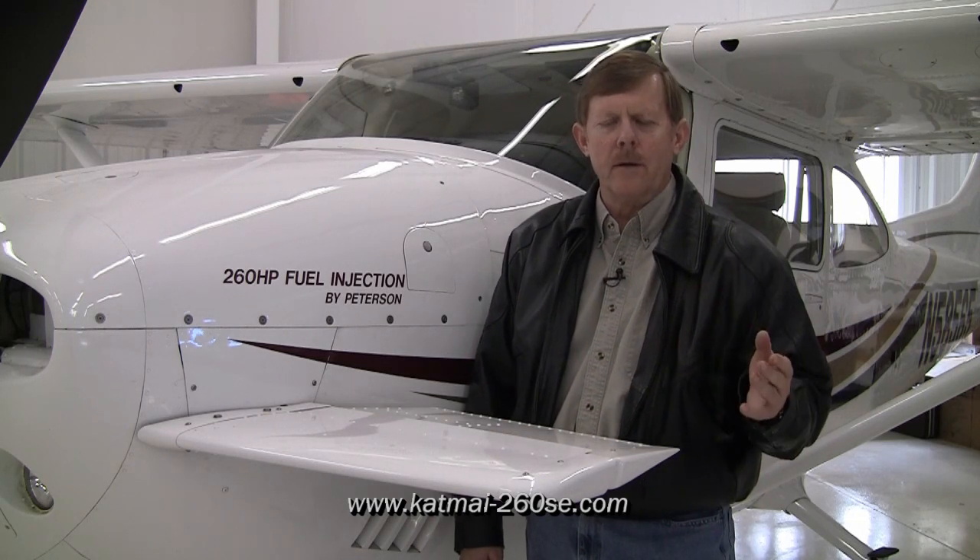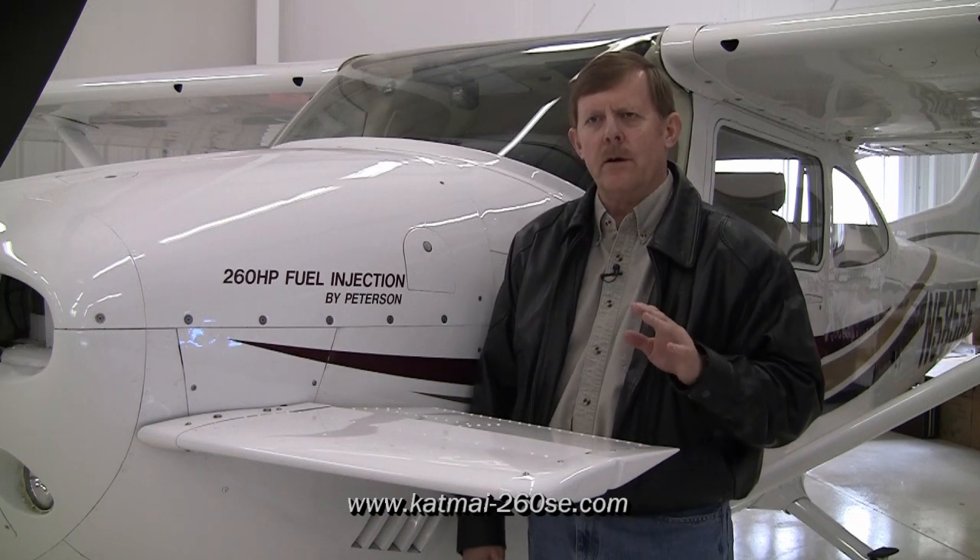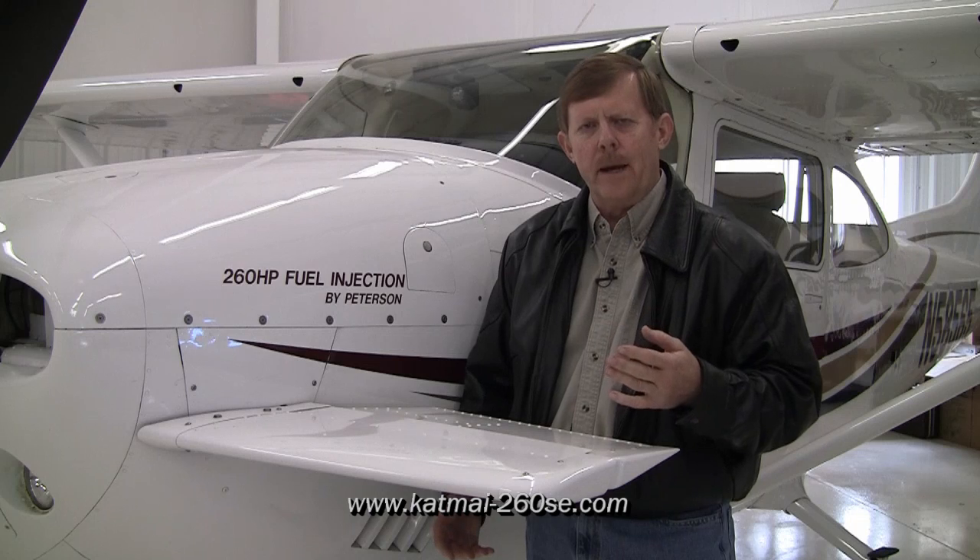The canard also allows you to fly slow and stay in a very, very safe flat attitude. It's not like other aircraft that are way behind the power curve with high angles of attack. If you look at some of our videos, you'll see the airplanes coming off the ground in the low 30-knot range. As soon as you come off the ground, you simply release a little back pressure, and the airplane will automatically rotate to a nice, safe, flat attitude at about 45 knots.